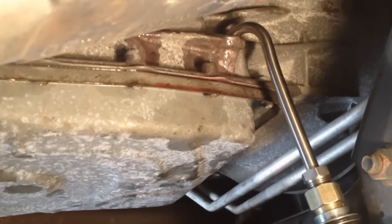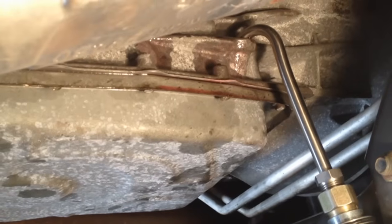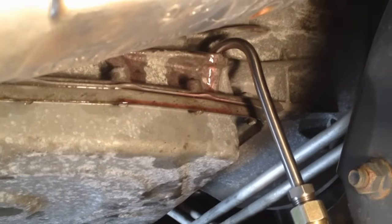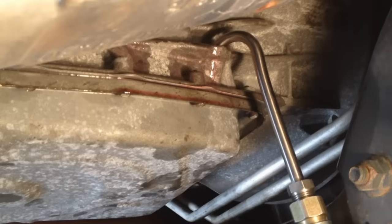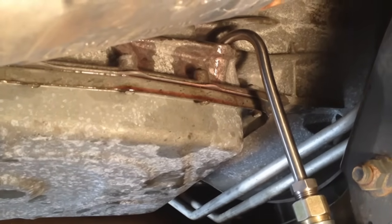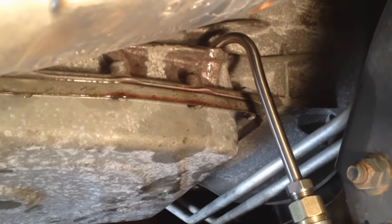In order to fill it up you need to do something like this, or if you have a suction gun you can use that and just curve the hose up and around like that. I've got an actual hook type style here. Go ahead and fill it with four and a half quarts or so and you'll see it'll come out the top a little bit. That's good. Now we're ready to go ahead and start it, and then we can come back down and adjust the fluid level once it's running.